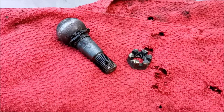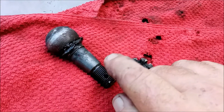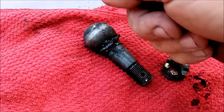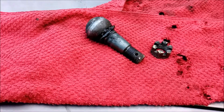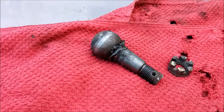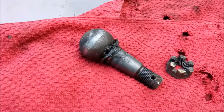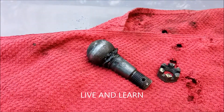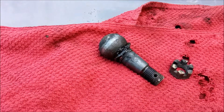If I had to do it again — and I'm going to do it again on the other side — I would just break this loose, take the four bolts out that hold the ball joint assembly on, take the tie rod end loose, and pull the whole thing out as an assembly. That should be a hell of a lot easier than what I tried. And honestly, if you've lost a ball joint, your front end assembly is a mess anyways — you probably need to replace everything. If you take a pickle fork to that tie rod end you're going to destroy that boot, so you'll have to replace it anyways. I took the long way around primarily because I was trying to get it on its feet sooner, but it ended up costing me a lot of time.